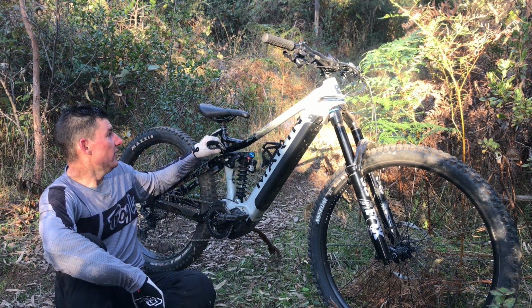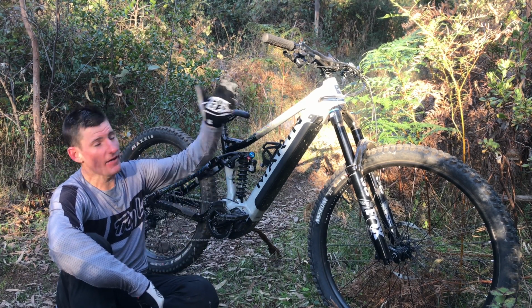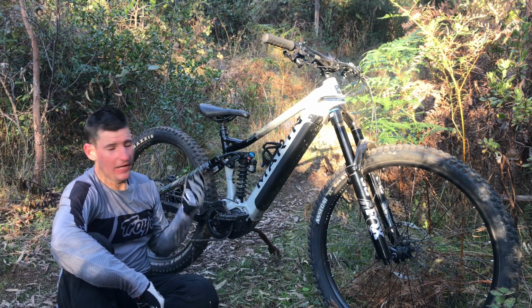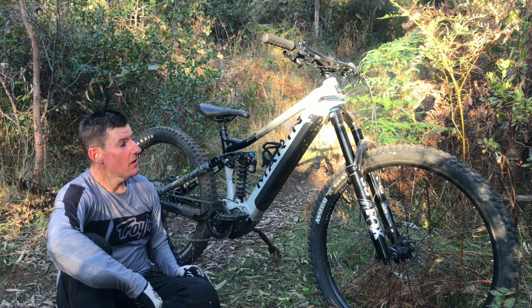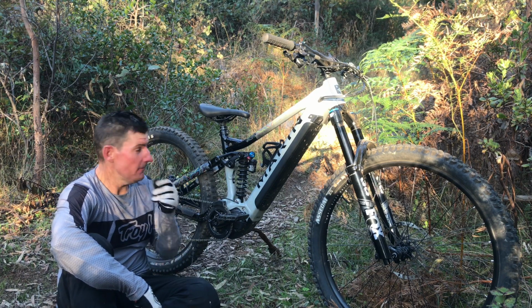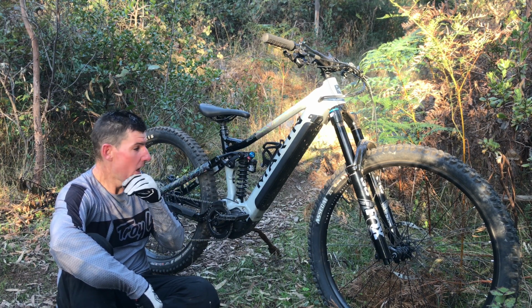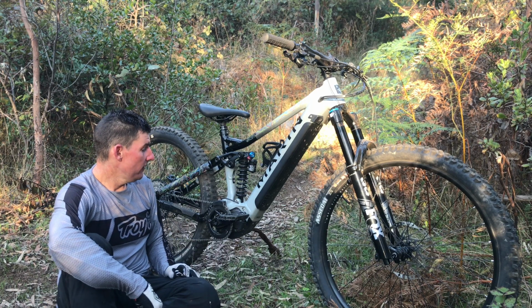Fusion X, dropper's killer. The componentry on this bike's perfect. SLX brakes are so strong. 200 rotor at the front, 200 rotor at the rear. Heaps of power all day, consistent. They could do with a bleed, only because when I had it upside down, I was noticing it was wandering a bit. The bite point was changing a fair bit, so that could be bled and improved. But functionally on the trail, no worries, no wandering bite point, no nothing.